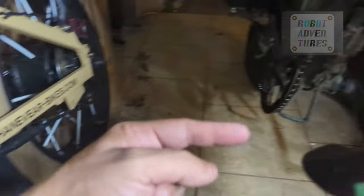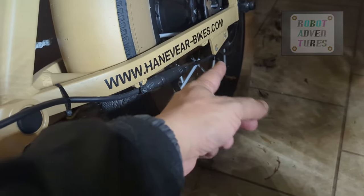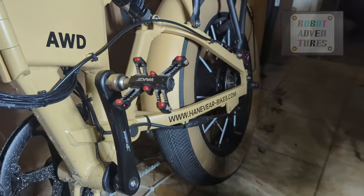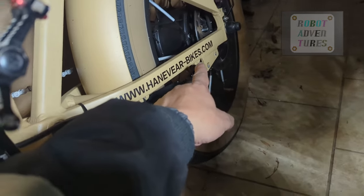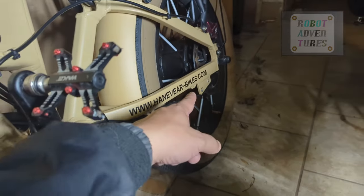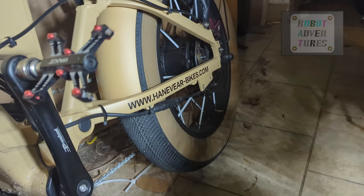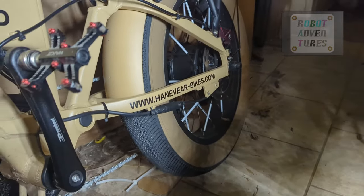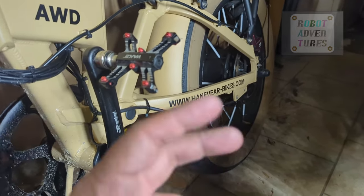The same thing happened with this bike — the kickstand wobbled. The wind blew it over about three times already, and the screws on the kickstand got bent. I had to go to the hardware store and get some M6 bolts at a threading of 1.0 to fix that up. That was a small issue.